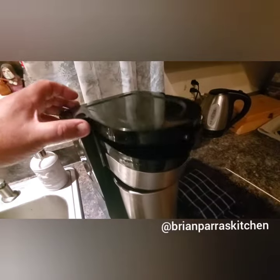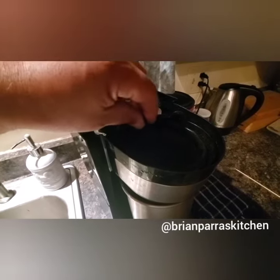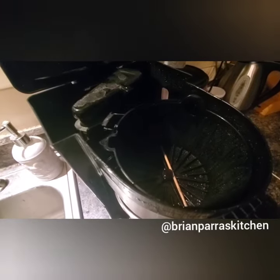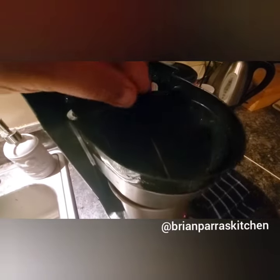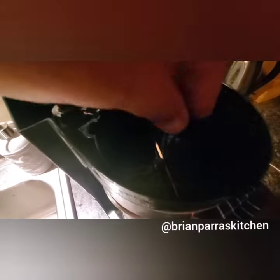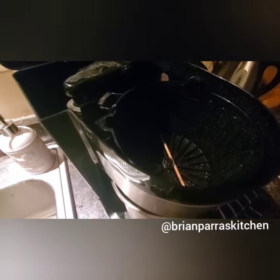Then, of course, you have to bypass the automatic shutoff system. When a normal coffee pot is in, it's open to allow coffee to pull through, but you can pull the pot off while it's still brewing and it shuts it down. There's just a plunger at the bottom that drops down and keeps the coffee from coming out when the pot is gone. So I just took a bamboo skewer, broke a piece off, and stuck it in there to hold that plunger up so the coffee will flow regardless of whether there's a pot in there or not.